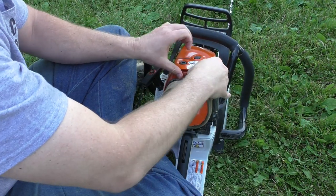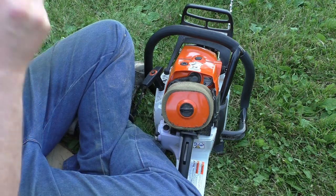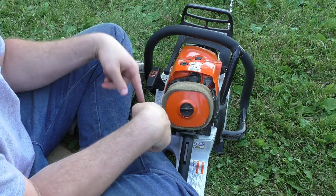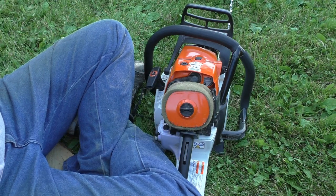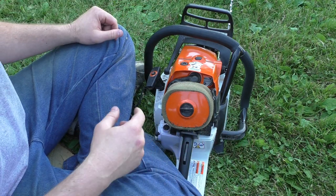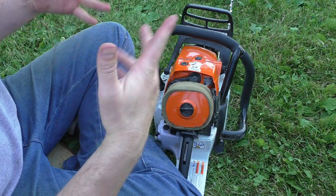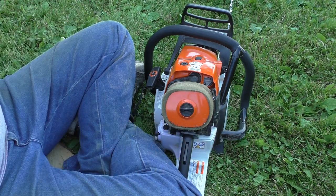Alright, now spark plug boot. Now we are going to grab our sunglasses, ears. We're going to calibrate it. This is again the version 3 coil, which has the white solenoid, the orange pickup body, and the newest 4702 module coil, whatever you call it. That has the version 3 calibration, they call it. You warm up the saw, then run it on choke for 40 seconds, and then you hold it wide open throttle, and it goes ballistic. You wait for it to stop going ballistic, and then you turn it off. So we'll do that.